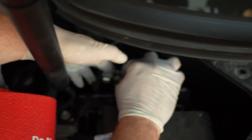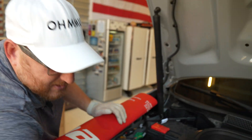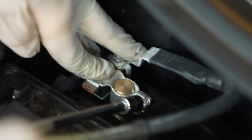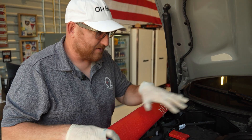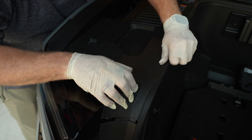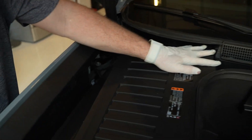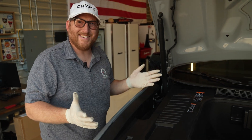Beware that your car alarm may go off right when you reconnect — it also may not. Now that that is on, we will snug that tight. The last step will just be to put the plastic cover back on — it goes back on the same way it came off, just line it up and push all the snaps down. Make sure you get your rubber out of the way so it doesn't pinch it. Once all of those are snapped in place, you're good to go.